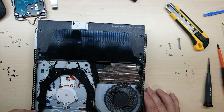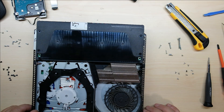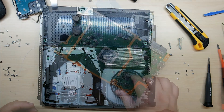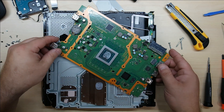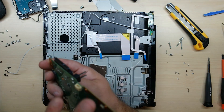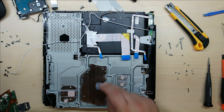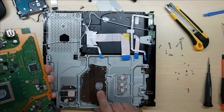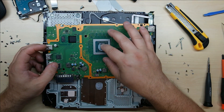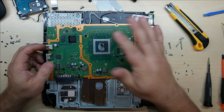I'd like to get down to the CPU and repaste it, but getting into this thing is so convoluted. I got the motherboard off from below — it's a bit of a pain. There really isn't anything below the cooling fan; the heatsink passes right through here. This is where the CPU and GPU do a direct attach — and yeah, that thermal paste is pretty much dried. It's a little liquid but barely — we're going to repaste it.